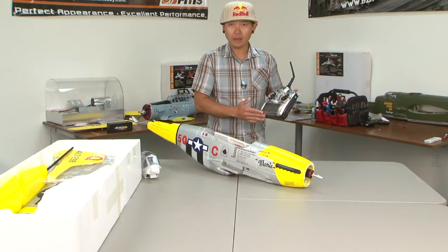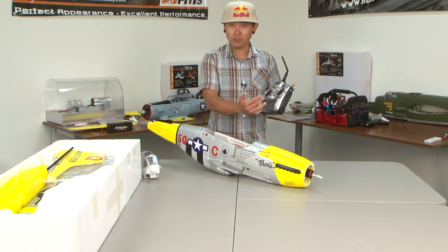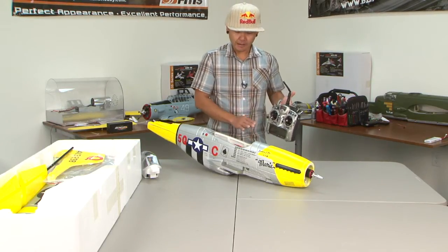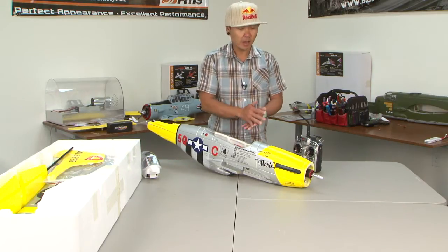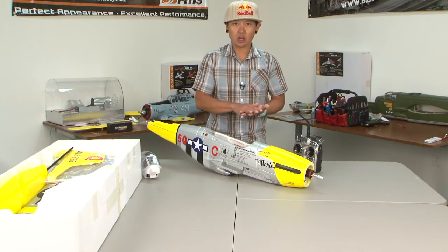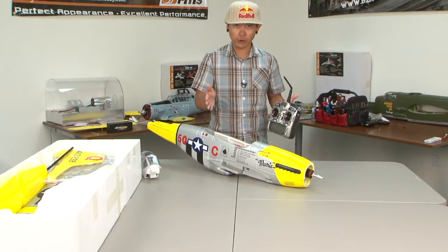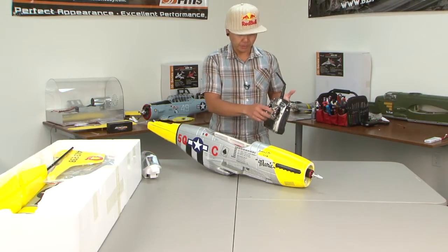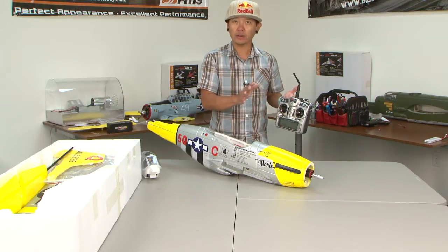You want to leave your EPA — if you're running JR, it's called travel adjust; if you're running Futaba or HiTec, it's called endpoint adjustment or EPA — on your throttle channel, leave it stock at 100-100, 100 on each side. Don't touch those numbers. All you have to do is perform the stick endpoint calibration we just did from the get-go and she'll be ready to run. This speed control is already configured for this aircraft and outrunner motor, so there's no additional programming needed. If you open the box and plug in your battery and get no tones but do have servo movement, follow those steps and perform the throttle endpoint calibration.